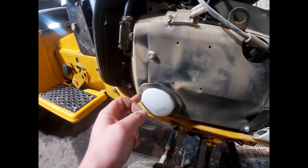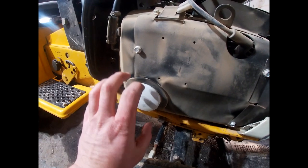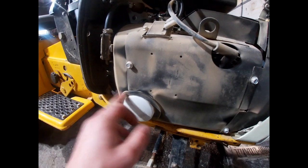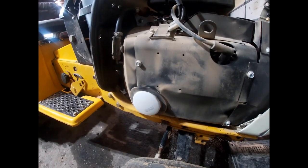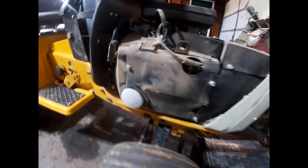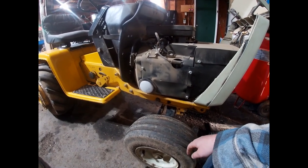It does what it can to prevent cooling air from being blown out of that hole and lost. All of these Onan engines came with this piece from the factory, but usually over time, somebody will do an oil change, pull it off to remove the oil filter, change the oil and filter, but won't replace this piece — they'll just throw it away. It's unusual in this day and age to see an original engine that still has this piece intact. Up until a couple years ago, I didn't even know it was a thing.